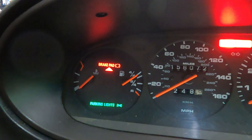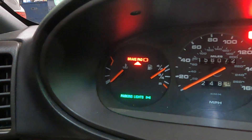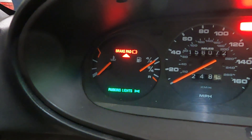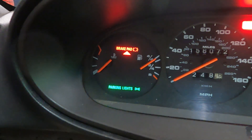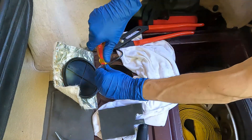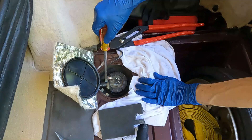That's about as high as I've seen it. It might be worth trying to clean out the sender just to see if we can remove a little more resistance out of that and get this gauge as high as we possibly can. To take the fuel sender out you just have to take these two hoses off — one of them's a return and one's a vent.